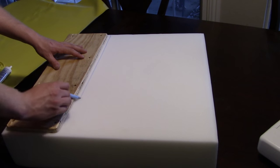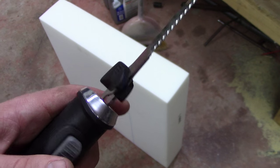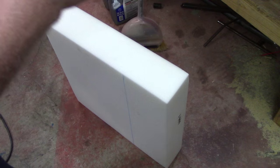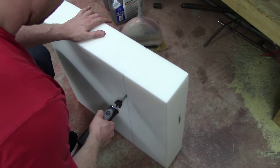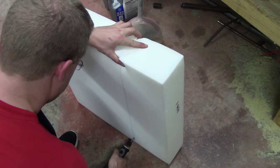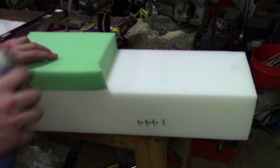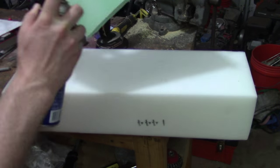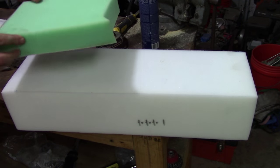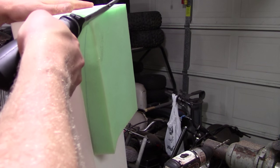The next step is to use your high-density foam and put about a half inch to an inch overlap on the edges. Then use a reciprocating knife — this is actually a fish filleting knife I have and it goes through the padding just like butter. It did an excellent job of cutting everything out. Now optionally, if you want a little hump on the back of the seat, you can cut out the padding or add a little bit more on the very back. I added some spray adhesive and glued it right together — that makes a more permanent bond.